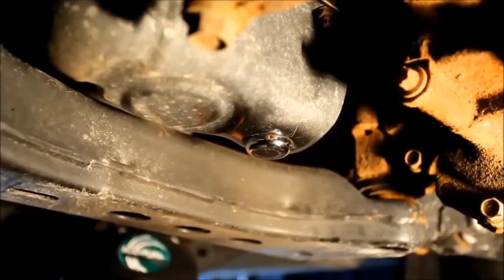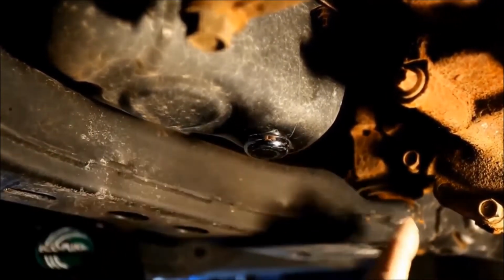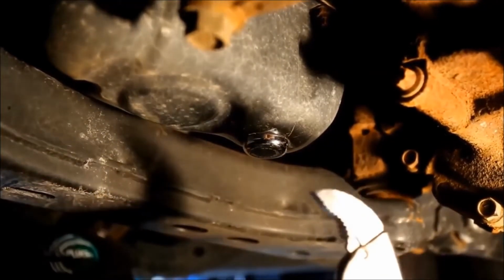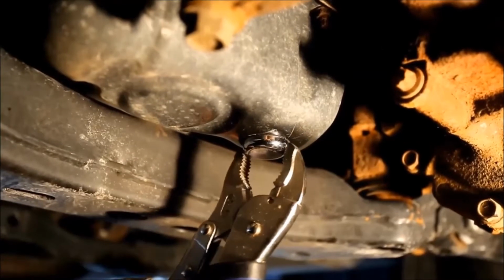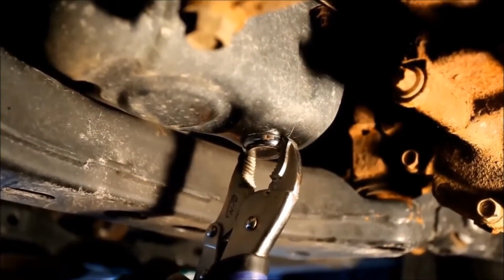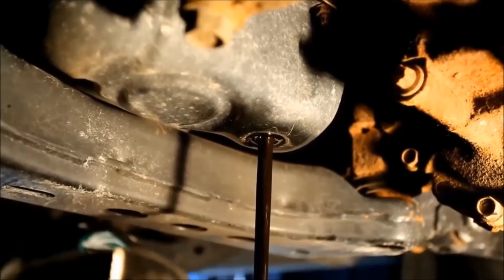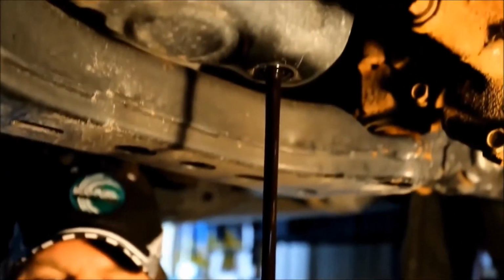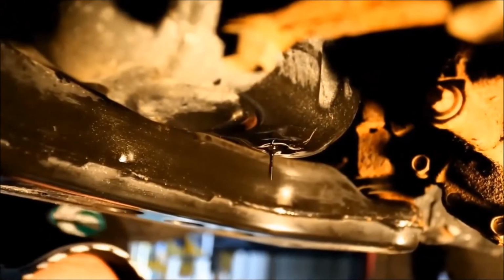Now we're going to do it from a steel oil pan using either our tool, which we showed you in the display, or a pair of common ordinary vice grips. It's very easy. Attach the vice grips to the eco plug and pull to remove. There's your eco plug. My hands are nice and clean. A quick drain of the oil. Very safe, very efficient.